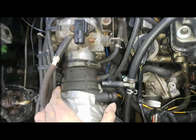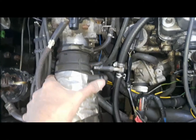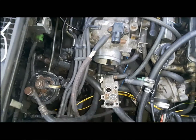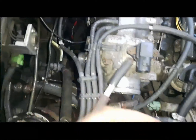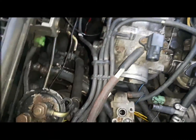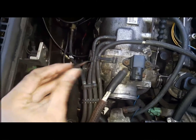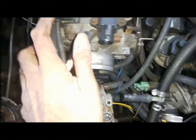But there is also a fast idle control valve — fast idle controller. If you take the intake off, I already took it off. So either it's right here, or on some engines, some throttle bodies, it's right at the back. You'll see there's a cap that looks like this — on the side or at the bottom, back on the bottom.